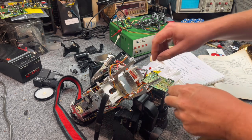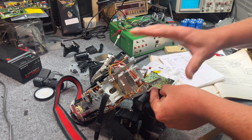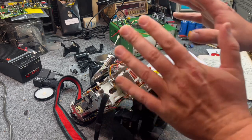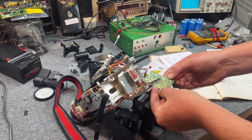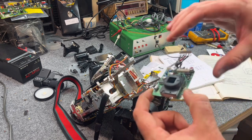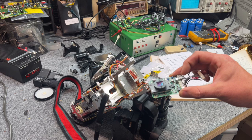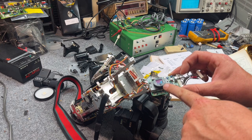At that point I had a good recorded image. Autofocus wasn't working because the belt's bad, and I really didn't see any obvious fogginess to this imager at first. But if we take it out — getting to this assembly is quite a process — and look carefully, you can see it: right there on the right side there's a haze in the filter.